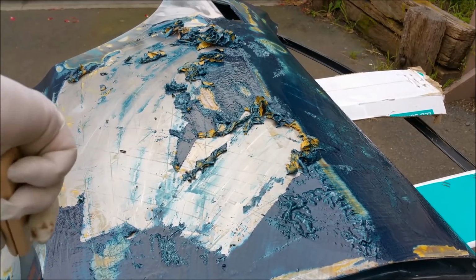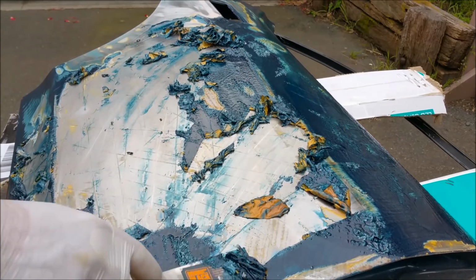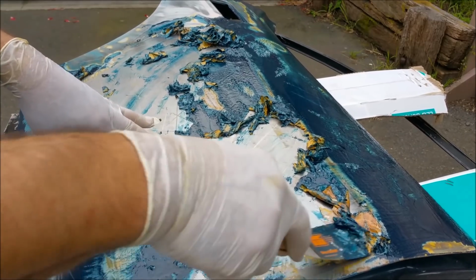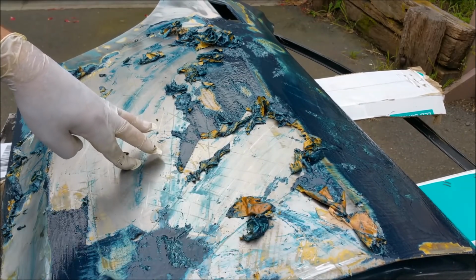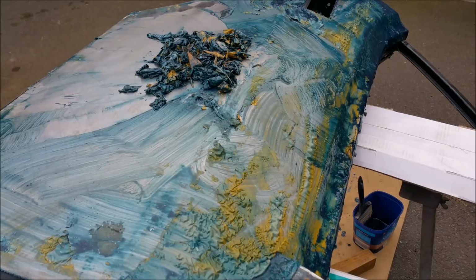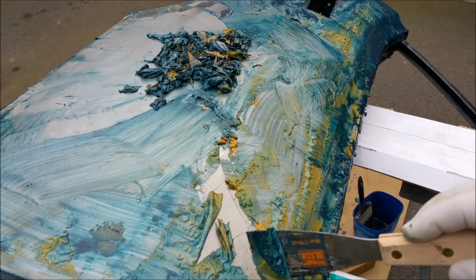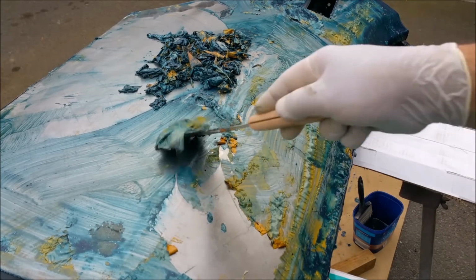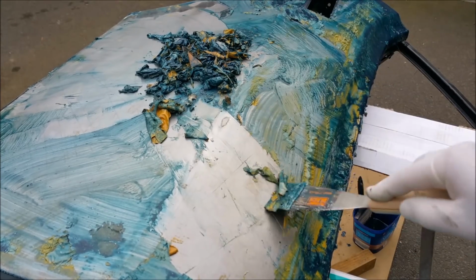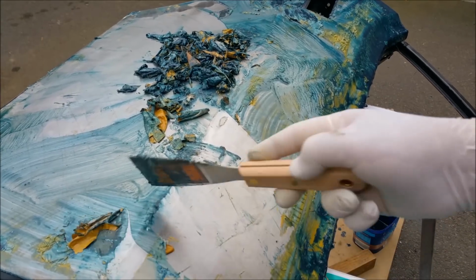I'm just going to give it another hit. Okay, so there's bog in the corner which it hasn't lifted. It doesn't like bog. You'll find this bog there, there's a low there. Anyway, I'll just keep going. This isn't bad. This is only the second application. They've put more spray putty here than in the midsection of the door, I suppose, because that's where most of the light reflects that you see. But this door looks really good compared to the other one. And I thought the other one was better than this, but see, this is spray putty here.